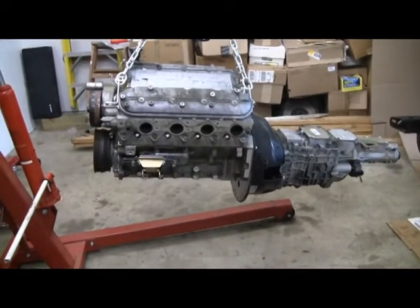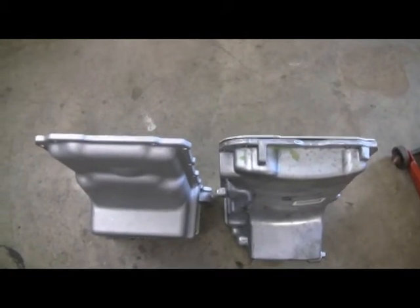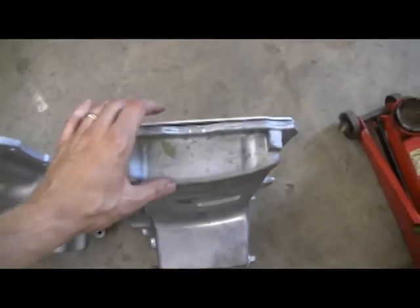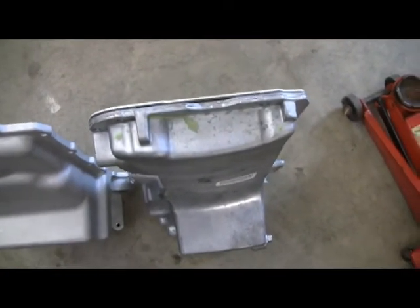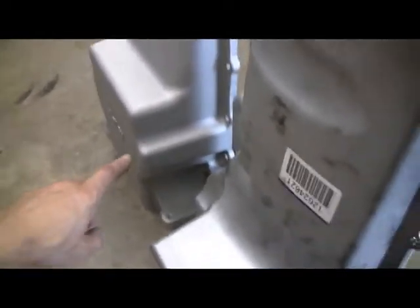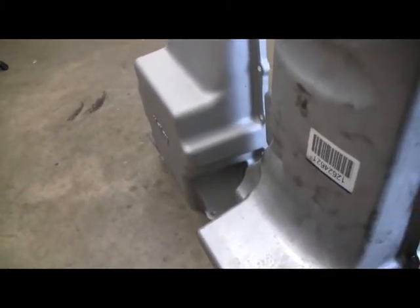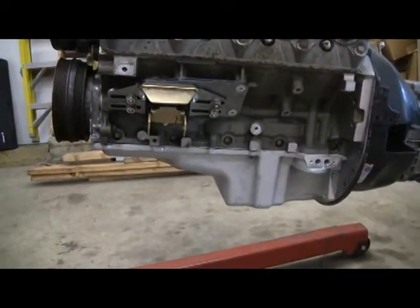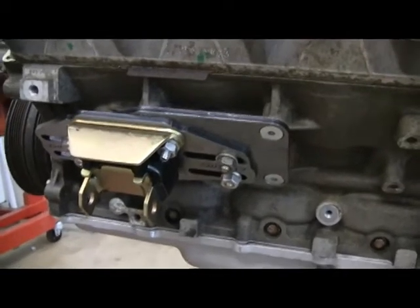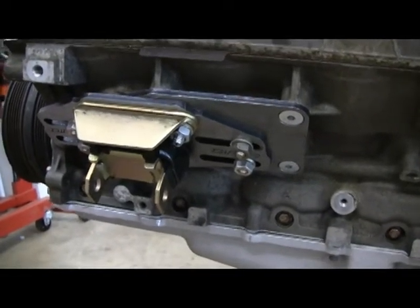Okay, we pulled the engine and took the oil pan off. I just want to show you the difference between these two pans. The one on the right is what was on the car — that's a GM muscle car pan. The one on the left is the new Holley pan. See how much thinner this is here compared to there? So now I'll be able to have more room to lower the engine. The sump area is also much higher on the Holley pan. I've measured and I should have enough clearance for the crossmember. We're going to put the pan on and find out. We'll drop it by changing these motor mounts — the Dirty Dingo slider mounts have two plates making them very thick — so I'm going to take those off, put on the single plate ones, and put it back in the car.